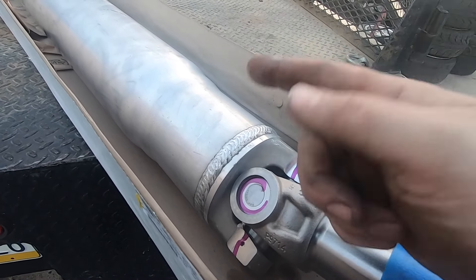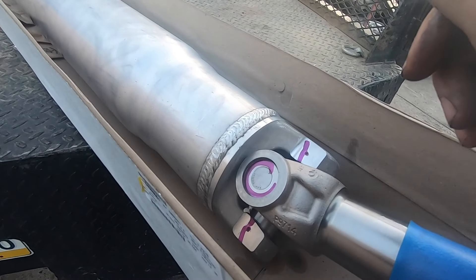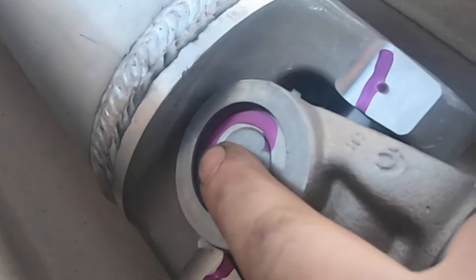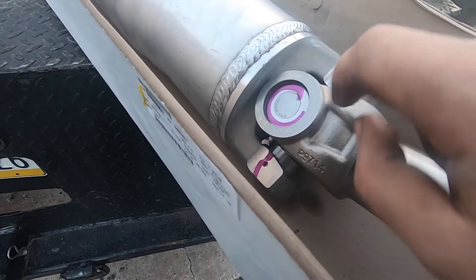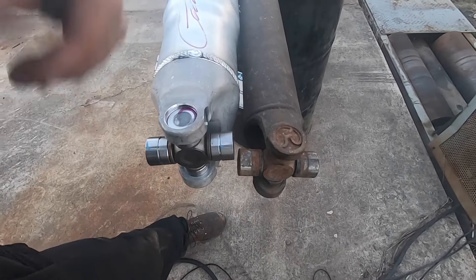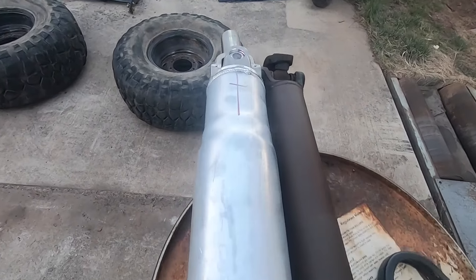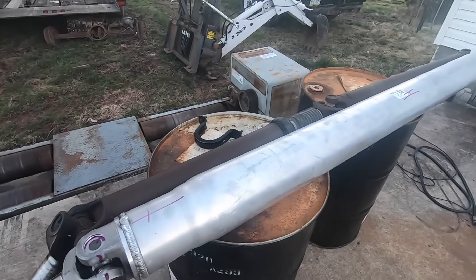If you've got an automatic, you'll probably want to change your rear yoke over on your rear axle — very easy to do. They do give you snap ring grooves in here, though they are not used on the factory drive shaft; they have nylon-injected retainers, kind of like you see on a lot of these trucks. Look at the size difference of this unit. The lengths line up really well — it's going to be a direct fit.